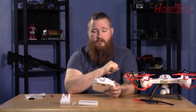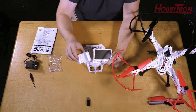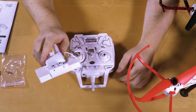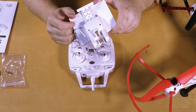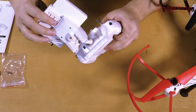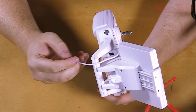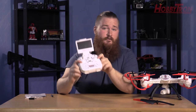At this point you're ready to fly. You can fly your drone around and tell it to record things, but you won't be able to see through the monitor yet. To use your live view monitor, grab it out of the box — underneath it you'll find a holder. One side of the holder extends and you use that to clamp it around the live view monitor; it's a very secure, very tight hold. On the back of the monitor holder you'll find two circular clips going vertical and two half-circle clips going horizontal. The half circles attach to the handle of the transmitter and the circles go around the antenna as you slide it down — with a little force it clips into place. Don't forget the wire, which connects just between the handle and the monitor on the top of the transmitter. Your transmitter and live view monitor are all set to go.